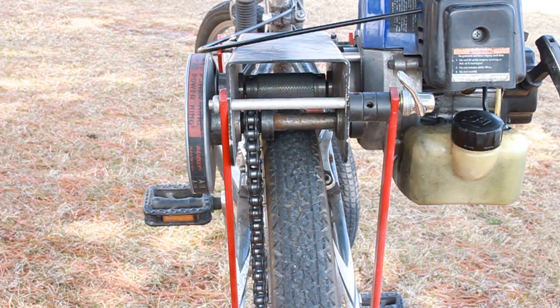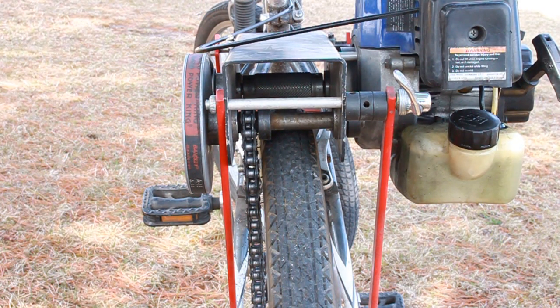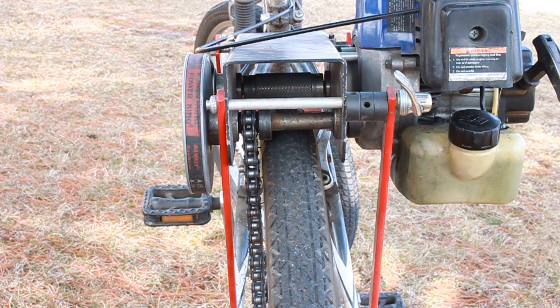The kit has really been great. We manufacture and sell friction drive kits, and truthfully, as well as they work, this just works so much better. I just wanted to give you a little demo — I'm going to take it for a little test ride. This is a 52cc engine, so it's pretty powerful. I'm about 225 pounds and this moves me around nicely. If you went to the Honda GX35, you'd have to go to a larger sprocket, and that is another change I did make.